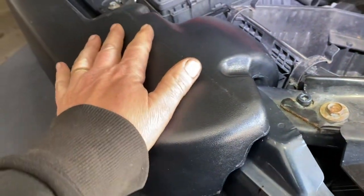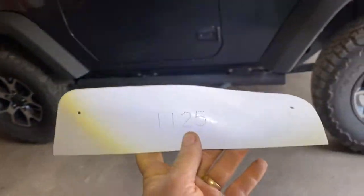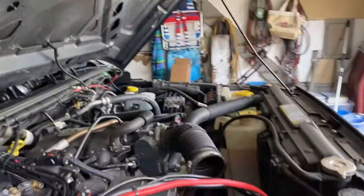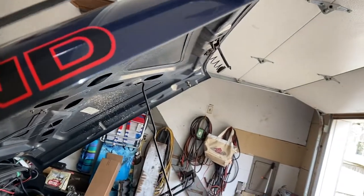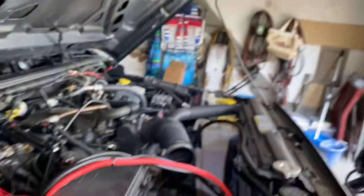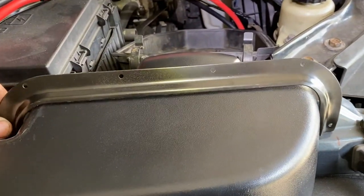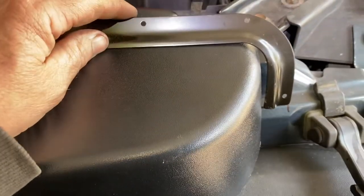The only part I don't like is how they tell you to use the template. They want you to put it back 25 millimeters from the hinge and cut your hole. I'm not doing it that way and I don't recommend you do it that way. Instead, I'm making believe the hood is already closed with the trim piece on. You measure as if the whole hood is going to close, make sure you have even space on each side, and put marks — a mark there, a mark there, and a mark over there.